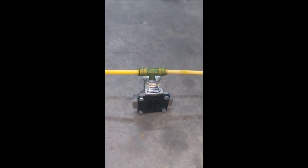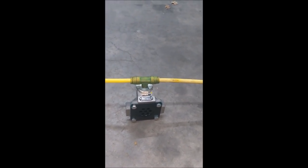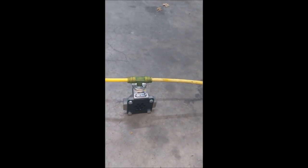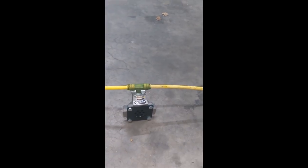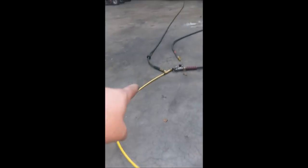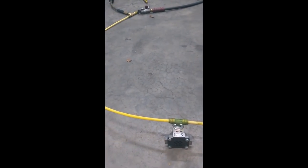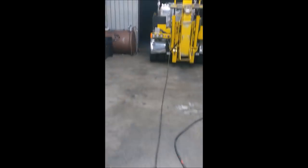This fitting is in front of the fifth wheel — this will be set up in the front of the fifth wheel. This isn't the valve for the Peterbilts, Kenworths, International Pro Stars, and Volvos, but they're going to be set up in some fashion like this in front of the fifth wheel. On the International Pro Stars and Volvo tractors, it's going to have a T in it like this. You would unplug the driver's side airline from the tractor and run your plastic line and tie it into that valve — you've released the brakes on the truck. If you have a trailer, use your T and hook up the airline. Now you've released truck and trailer brakes with one airline off the wrecker.